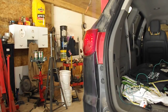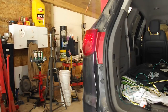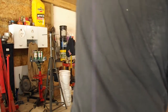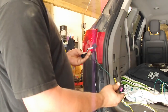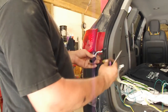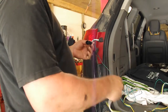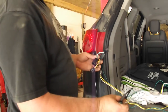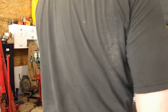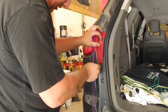Now that the hitch is installed, we're going to go ahead and install the wiring. It's pretty simple wiring — what they like to call plug-and-play. You pull the tail lights out, plug these harnesses in place in conjunction with the tail lights, then run the wire to the other side and tie the four-pin connector up underneath near the center of the hitch. We'll take a small screwdriver and pop these tabs off.